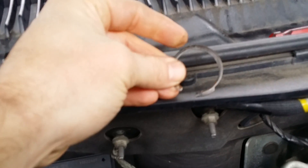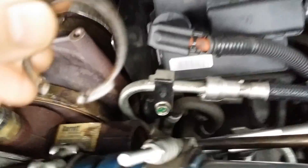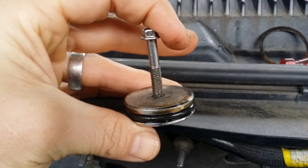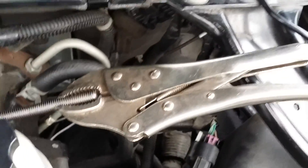Then I take the snap ring out from the turbo vane actuator. Then there's a plug — I use the same size 6mm by 1.0 pitch bolt to pull that out. Underneath there is the plunger. I made this little rod with a catch on the end to kind of jam in there.